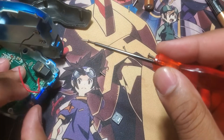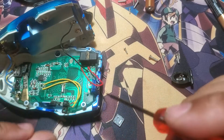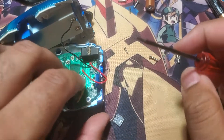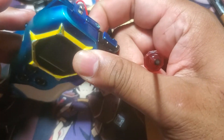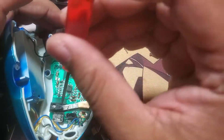That was the issue I was having — the screen wasn't making proper contact with the motherboard itself. I have to be careful because I don't want to apply too much pressure and shatter the screen. I'm not even in the screw post — it's just free spinning. Let me get it out of there. It seems like there's too much space, so I'm going to rewind. I hate taking this off again, but I have to.